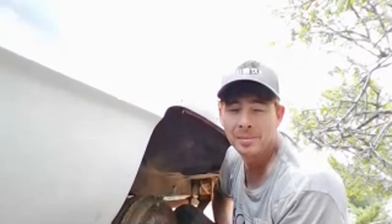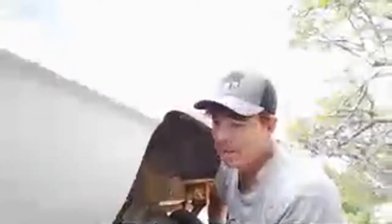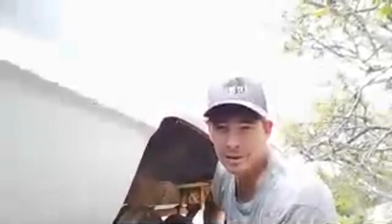I'm trying to think of what I'd have here at this house that I could use. I guess I could suck it up with rags, but with the back seal already leaking, we're just going to need to go get a master cylinder for it. And at that point, if I'm doing a master cylinder, I really ought to go to a dual circuit.